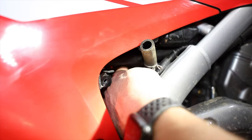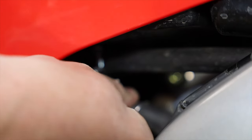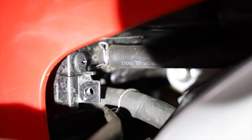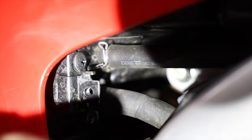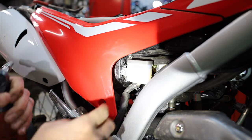Nice low, steady turn signal versus that crazy rapid one. The rapid flashing usually means one of your turn signals is out — that's how you know. This looks a lot more normal. I don't know if it's worth it for you, but I think it's worth it for me — it wasn't much more expensive, less than 20 bucks for the relay. We're good to go, let's put this thing back together. That was pretty easy — worth the hassle honestly.